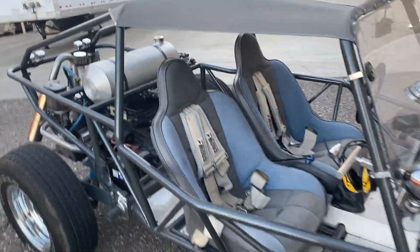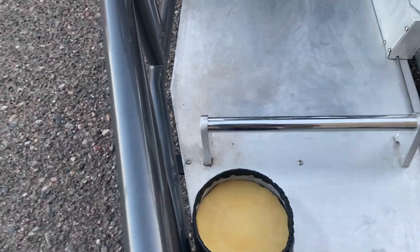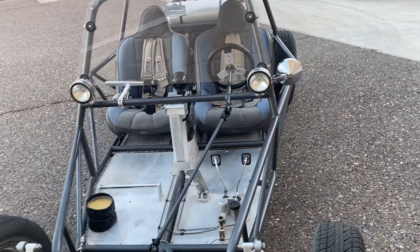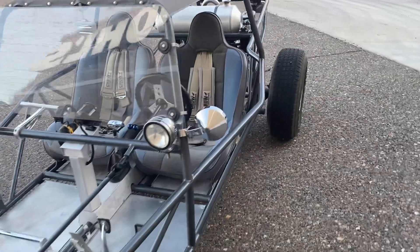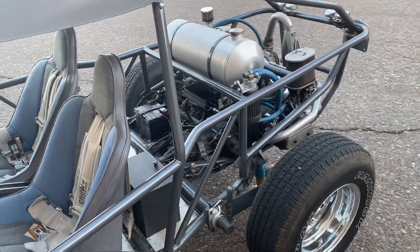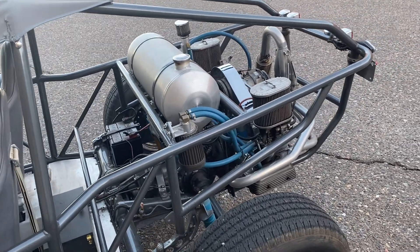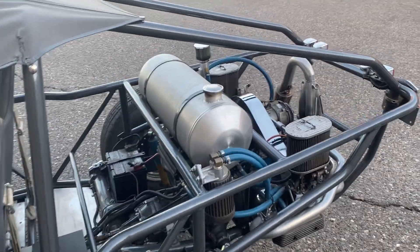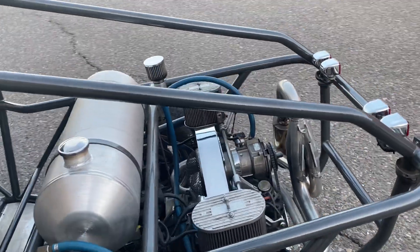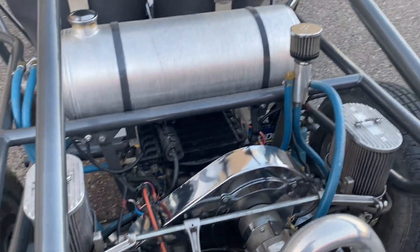Let's go back now and look at the entire car. I'm going to go over the features of this dune buggy's motor so you know what you're getting. A lot of these Volkswagens have little 1500 or 1600cc single port or dual port motors, sometimes bored out to a 1641 or 1776. This is neither of those — this is a monstrous 2386cc stroker motor. This is the way I got the car.